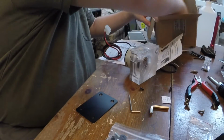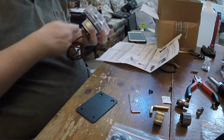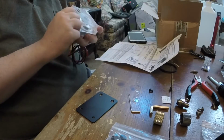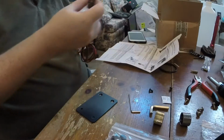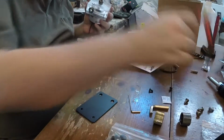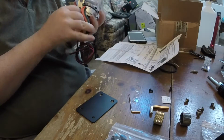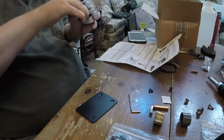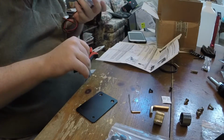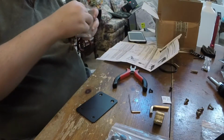Let's see. Pretty much everything these days, as far as the major water cooling makers, they all use these G1/4 threaded fittings. So there's no need to figure all that out. I think there are other threading types, but I think G1/4 is the most common. So again, we're just going to tighten them down a little bit more. And with this, you don't want to tighten them down too much because it is Plexi that you're going into, so just be aware of that. Let's get them down enough to where it's fairly secure, fairly not going anywhere. And then we'll go and put the fittings on top.